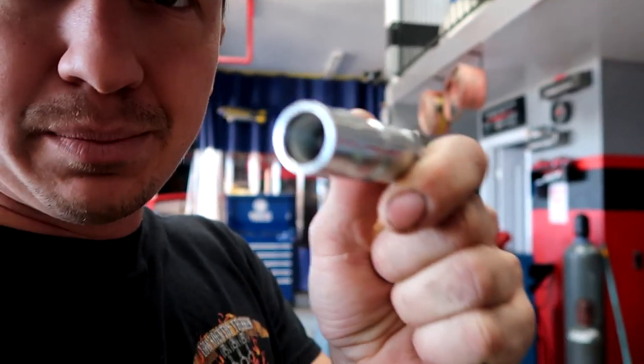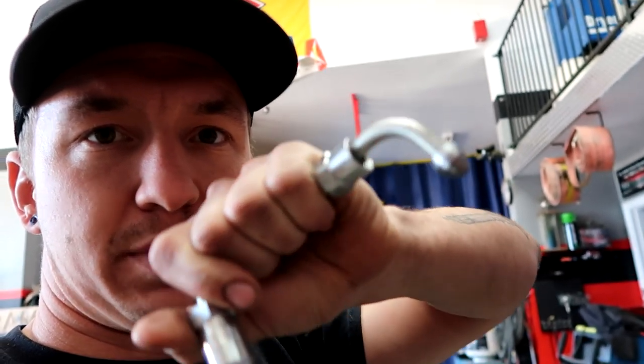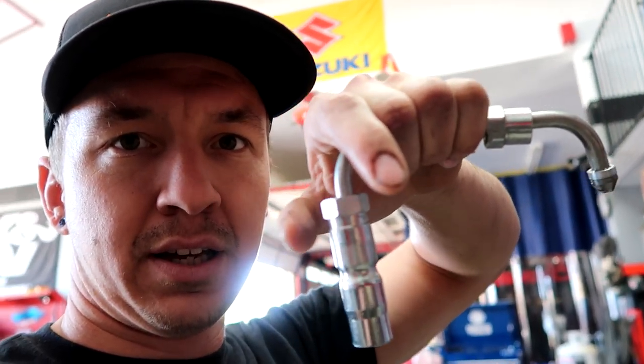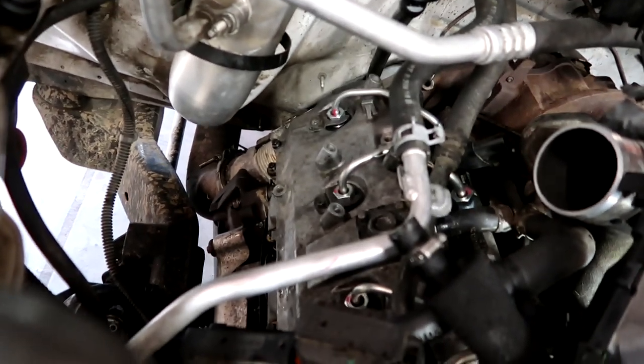The other valve cover is just about ready to go on, I just gotta change these o-rings and throw them on. Just a tip — what happens and why I had to wait and change these is they get cut when you thread on the hard lines. What I recommend doing is threading these down all the way first, set them into the fuel rail but don't tighten it down yet. Thread these all the way down hand tight first so that way they're seated on the o-ring and straight, then thread this on and torque them. That way they go on evenly, you don't mess the o-rings up, because that can cause a leak into the oil. We fixed one, we don't want to create another.